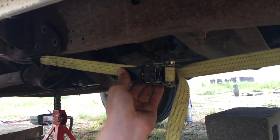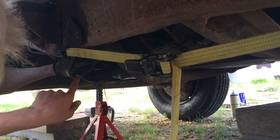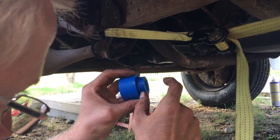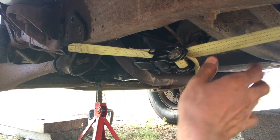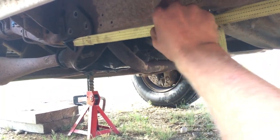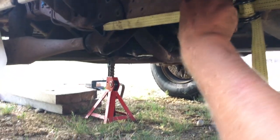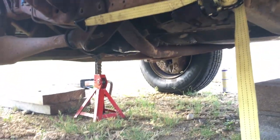You might find this is really stuck depending on the style of bushings that were there before. The really old style rear bushing had a longer inner bushing that would come out the front side, whereas the new style has two that meet halfway. Since it's been in there so long, sometimes they get stuck. One thing I found: you can put a strap on like this, find a strong spot on the frame to hook to, and then slowly ratchet it off and hope it comes off fairly easily.